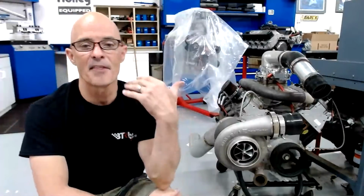Wherever the richest point is where they make the maximum power, that's where I leave it, because in my opinion that's the safest. When you're running the turbo motor, you're going to be running at 11.0, 11.5 to 1, something like that. Sometimes if we want to get really crispy, we'll run it at 12.8 or so. But usually it's going to be richer, so we have to add more fuel. That's why I always add the extra percentage, to make sure that it's rich. We want to start out rich, and that works because, by our formula, we're doubling the power output when we double the pressure.